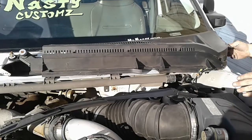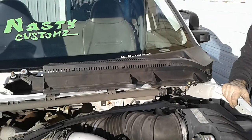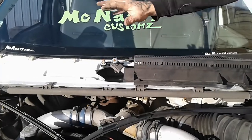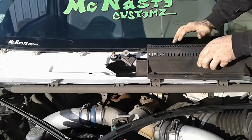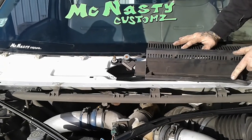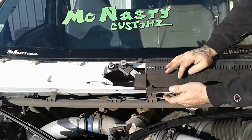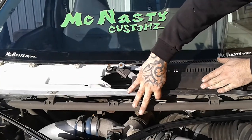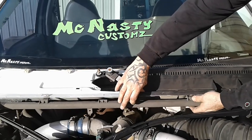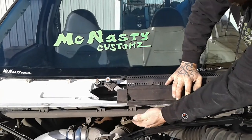This clip over here that we left will clip into the new fenders that you put on. The two cowl covers in the center will clip together. What I like to do is when you remove your cowl, remove your wiring harness and move it down — you have factory holes right here. When you have this on in the right place, find a factory hole from underneath, mark it, drill through, and put a bolt there. That will hold it on. If you do it right, you can put the cowl plastic and the wiring harness under the cowl, use one bolt, and it looks factory again.